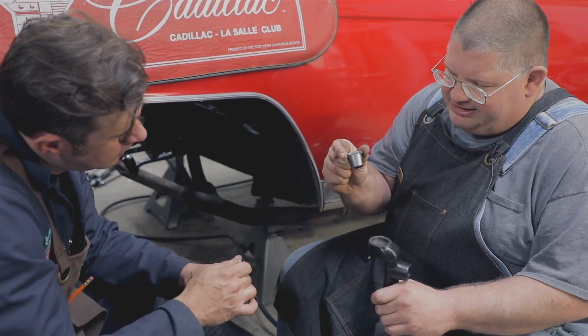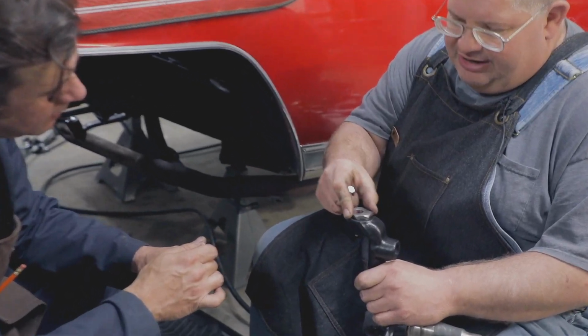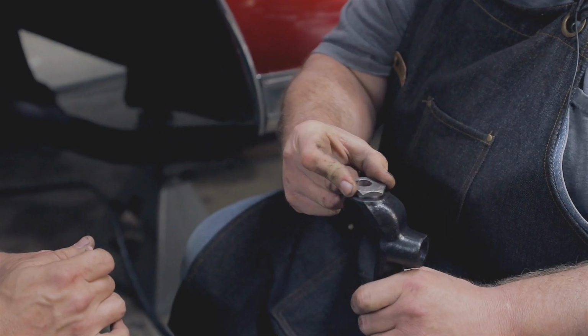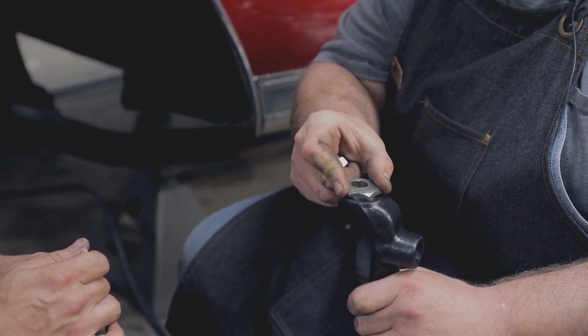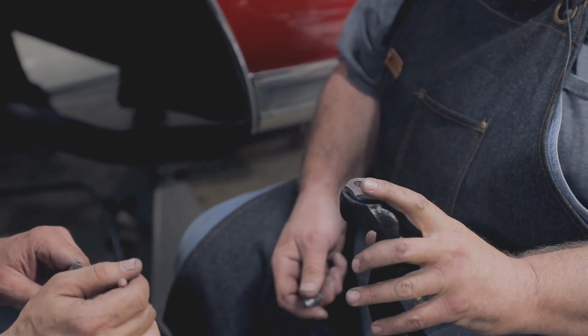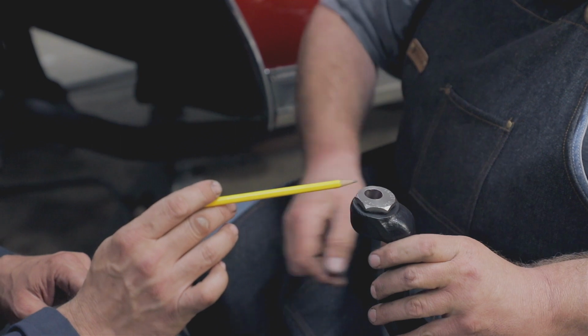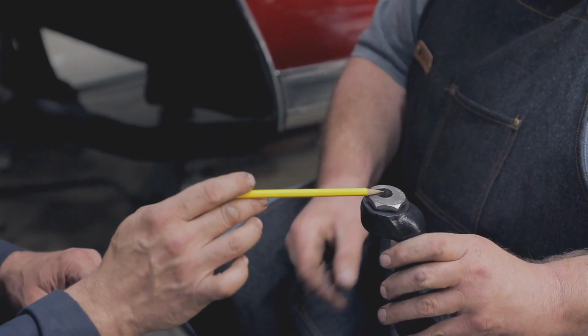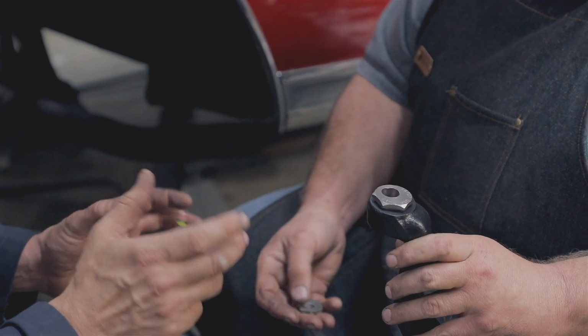This has been lubricated up a little bit because you do need to have it mounted and fairly tight, but still going to be able to put a wrench on here and turn this with the weight of the car on it, because the alignment has to be done with the weight on the suspension. It's good to note where the hole orientation is when you remove the other one, so you can get it back in the general area.